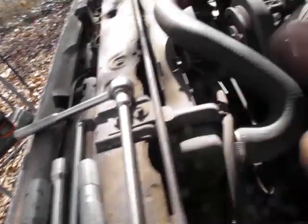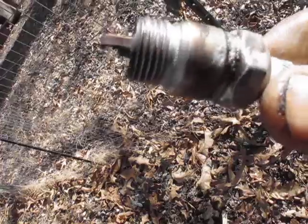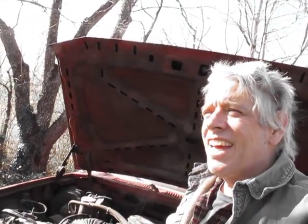Chase the spark plug holes, clean the chasing tool with some WD and dry it out, then put fresh grease on it each time so it catches all the stuff. Those threaded holes were feeling funky but now those two in the back feel much better — I should be able to torque those down to specs. The problem is the one underneath the AC compressor is going to be a little dicey to reach. You can see on these old plugs there was some gas or oil leaking past — there was bad gas run in this truck before I got it and some bent pushrod tubes, but we fixed all that. Signing off for now — thank you.